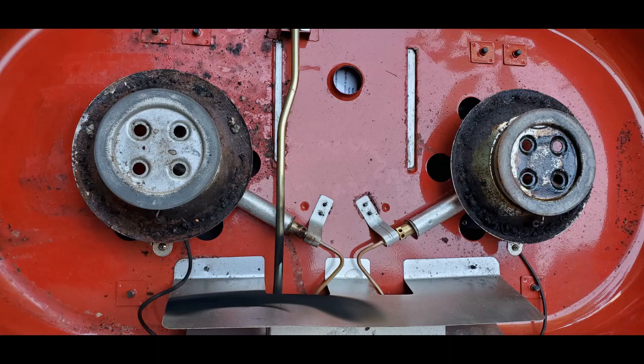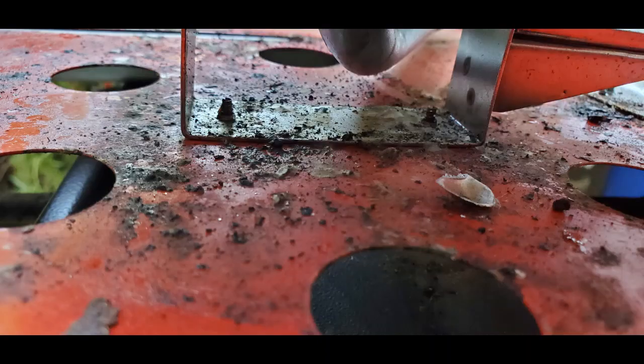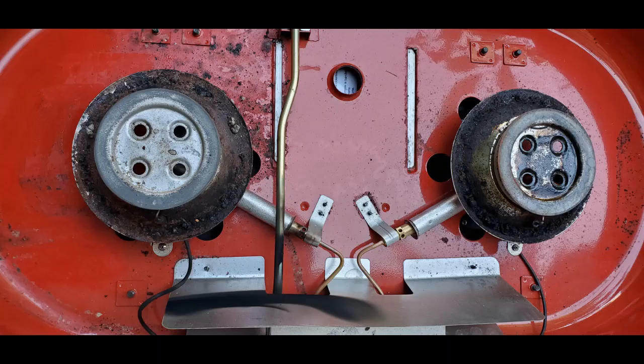We took the silver apron that collects grease and runs it to the grease trap off, then I started following the owner's manual. On figure 37 it says to unscrew one screw and take the burner off, but that obviously didn't work — the burner is firmly attached. I read some Amazon reviews saying it's like 14 screws because you actually have to take off the whole stand and the bottom of the grill to access the bolts holding the burner on. It's good that the burners stay put when you move it, but bad if you need to access the venturi tube.